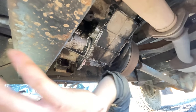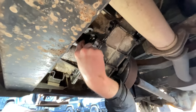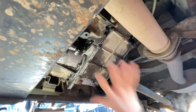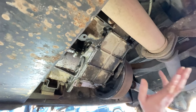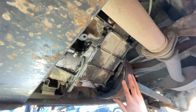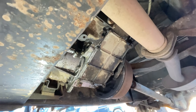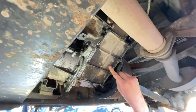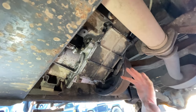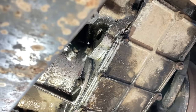Moving back, on any Defender you'll be faced with your gearbox and transfer box. Transfer boxes love to leak - they always leak from the IMS shaft. This will give you an idea of how much work the Defender has done. If this thing is a huge oily mess, it's been pulling a lot of weight, which means the vehicle's gone through a lot of wear and all the other components on the engine will be pretty worn. You want to make sure this is relatively clean - this all looks pretty good, it's still silver, and this is a 30-year-old vehicle.